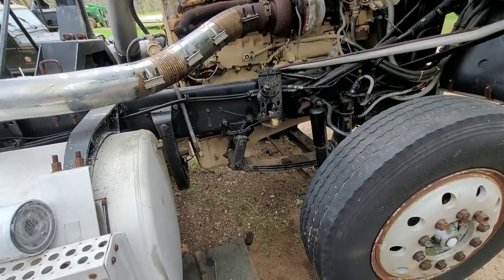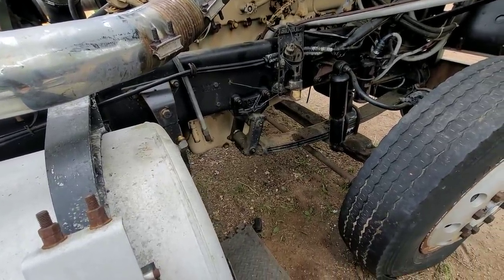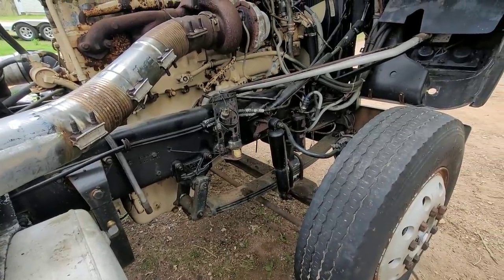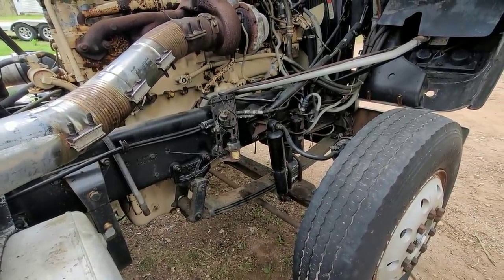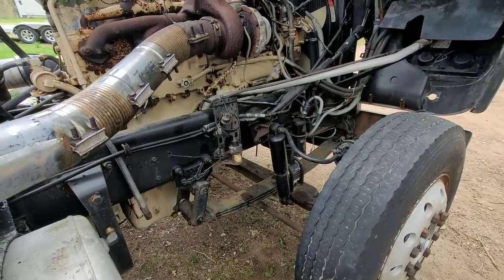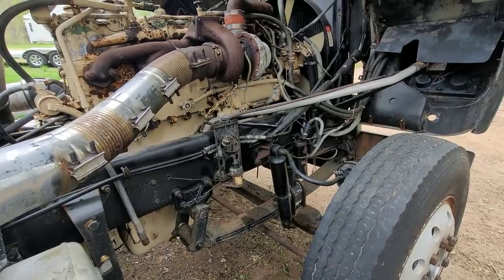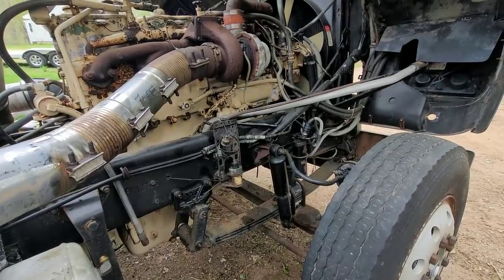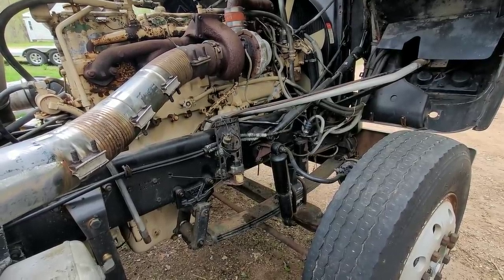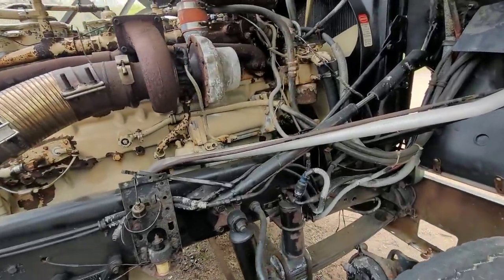You saw me pull off the oil plug and check the oil to see if there's any water in the bottom, and there wasn't. And then I just pulled off the oil filter, started to unscrew it, and the oil is coming out of it. So it's full. A dilemma here now. And according to the service, the oil is still good, even though it's not. It needs to be changed before it leaves this yard, but...